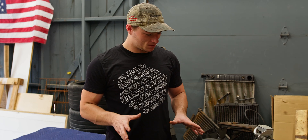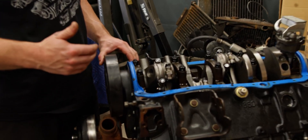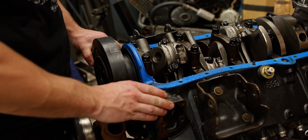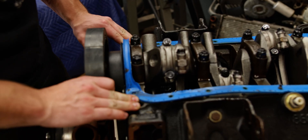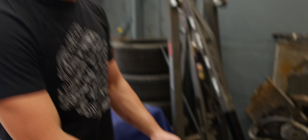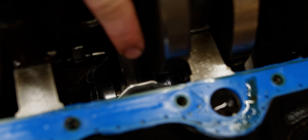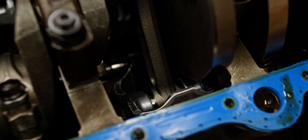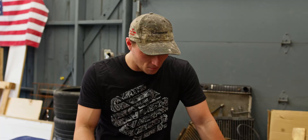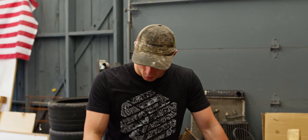So the main issue — and there's going to be a few more as we go along — is excessive forward-to-back motion in the crank. This is supposed to be about two thousandths, and as you can see we've got quite a bit more than that. So that's causing a couple of issues. Right away you can see this lobe on the crank was wearing into that piston there. I think I saw one other spot, but that's at the very least making this engine way less balanced than it was.